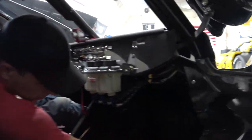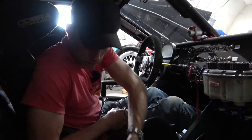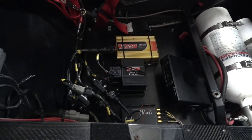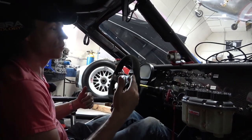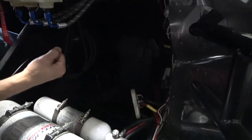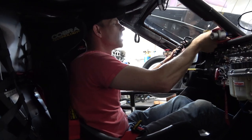This is the big master cutoff — your fail-safe to just totally cut power from the battery to everything. Even with all this technology, there are still things that matter in the real world. See all these electronic things? I don't trust them — they fail. But this switch is either going to work or it's not, and if it's up I know it's supposed to be one way, and if it's down another way. There's a lot to be said for something you can see and instantaneously know what's going on. That's why you see major physical breaks in the electrical — it's still important for the redundancy of safety.